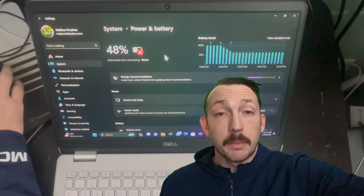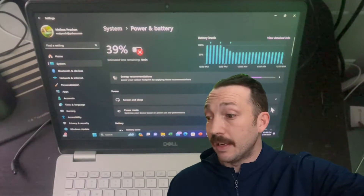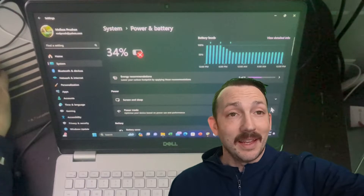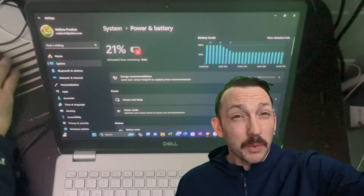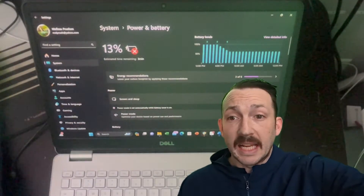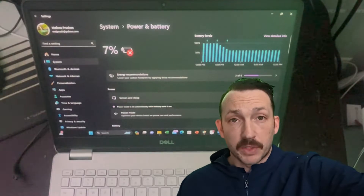This battery appears to be depleting very quickly. It started at 57% and is already at 39% within just a few minutes. It has an X icon as a symbol, which tells me it could be the drivers or a bad battery. This laptop was manufactured in 2018, so that's almost six years now. We'll replace the battery to start there and see if we can resolve the issue.